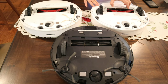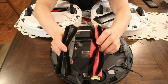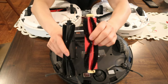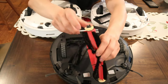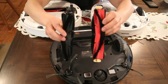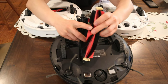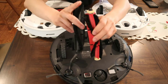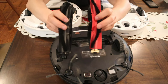Let's open up the extractor housing. The extractor bars are almost the same length, minus the shafts being slightly longer on the Roborock. The end caps can be removed to help remove hair — just twist them and they pop off. Both have a combo style of bristles and silicone, though on the Roborock the bristles are denser. Both robots do well picking up hair, but it does get tangled around the extractor bars, especially around the ends and middle — so keep that in mind with a lot of pet hair.